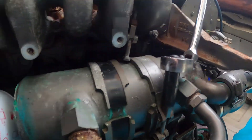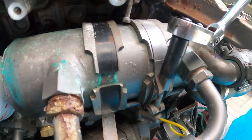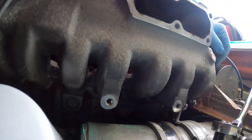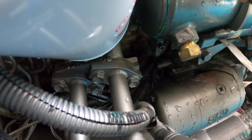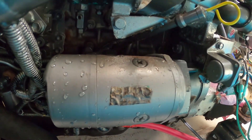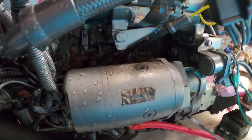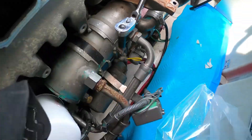The hose clamps on both of these have broken - you can actually see it spinning right there, and this one did the same thing. It's just so much rust and corrosion; you can see right here where it's been leaking really bad, probably from the charge air cooler as well. We've got our 12-millimeter bolts there for the two oil lines. I'm going to take off the whole bracket that holds this oil cooler on, because there's no way I'm going to get this off with the broken hose clamps. We have a bolt right here and another bolt that comes in from the back, as well as one right here.